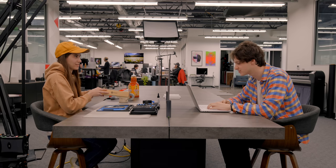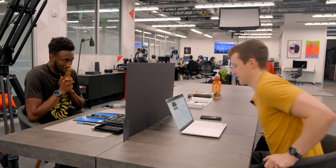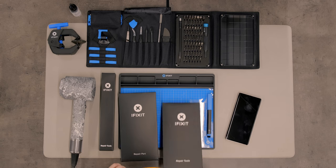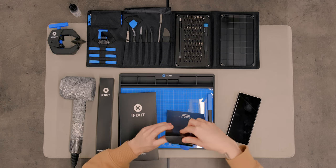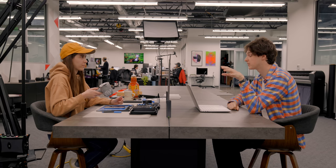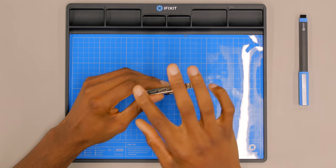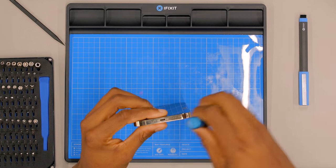The first thing we're going to do is take off the screen. I have a broken iPhone in front of me and an iFixit kit, so it's pretty obvious — we're gonna fix an iPhone 13 Pro Max screen. There's a repair toolbox, a repair parts box, and another repair toolbox. The first tools you'll need are the plastic oversized guitar picks and something that generates heat. Start getting the screen warm until it barely feels too hot to touch. Then remove the two 6.8 millimeter Pentalobe P2 screws at the bottom by the charging port.